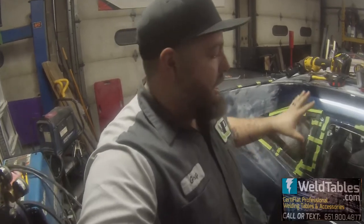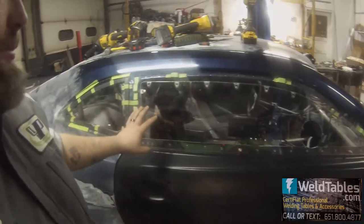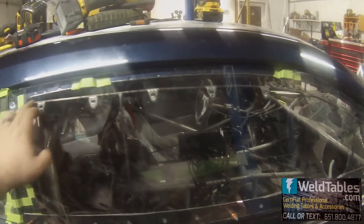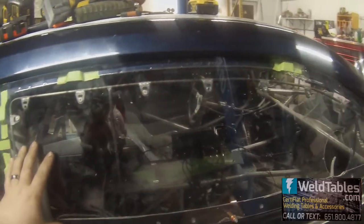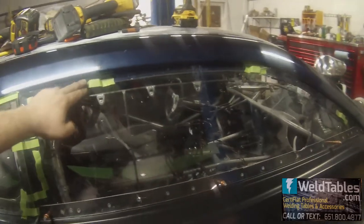We're back and I want to show you what we did with the windows. What we've got here is the Lexan windows. We made a template that fit inside and up in the window there. As you saw before, we already made the frame for everything to fit in and be able to bolt in. These rods — there's a rod here and a rod here — we actually made them adjustable with an adjustable heim on the inside, so we can adjust the pressure on there. There's going to be foam right here; the foam they sent is one inch and it was supposed to be half inch, so we just have a half inch piece taped up in there right now.